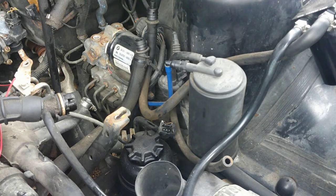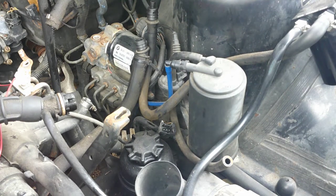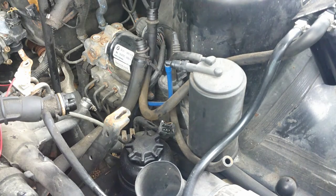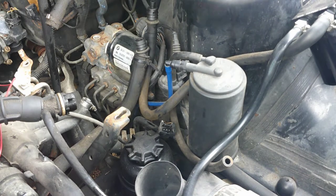All right, it's windy but here we are. I have the intake manifold off so you can kind of see everything easier. This is our charcoal canister — it's in a terrible spot. I've got my catch can off to the side; I want to put it right here, so we're just going to delete it. It pretty much has three lines going into the canister: two up top, one below. The one below vents to atmosphere, so we don't have to worry about that one as much. The two up top — the blue line is the one that comes from the tank to feed the charcoal canister to catch all the vapors. The black line next to it is the one that goes into the throttle body itself.